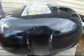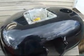The edges, these have to be really maintained, these edges of these sharp lines, especially on the fenders. They're going to go down to the metal, but at the same point in time, when the paintwork is done, they have to be built up pretty well, because these are the places, if chipped, that rust and such begins to get in. So we'll look at that as well. Okay, we'll continue. I'll get this taped off and we'll start at it.